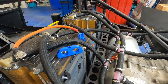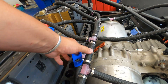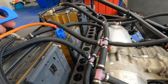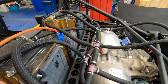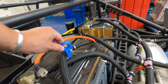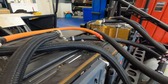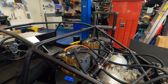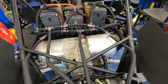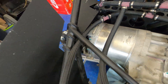It's kind of a mess — I haven't had a chance to tie all these hoses together and clean them up yet. But I've got these 3D printed brackets that I designed. I'm going to use these to hold the hoses together and apart from one another, and I'll make some brackets to hold them to the chassis. I designed this one to fit right here so that these two hoses aren't chafing against one another. On the other side up front, the hose comes to the drive unit — inlet to the drive unit is right here, and the outlet is nestled down inside there.